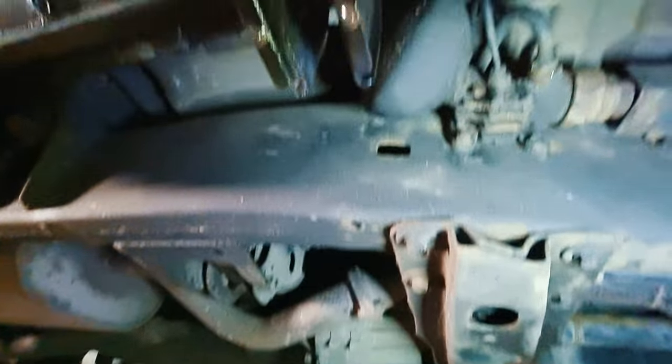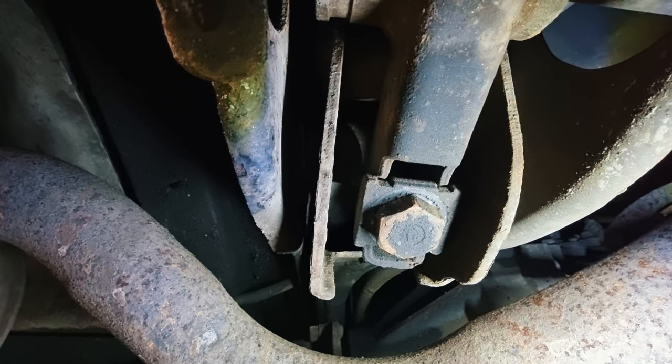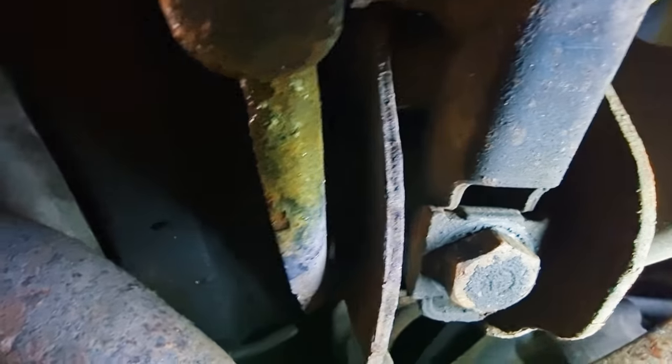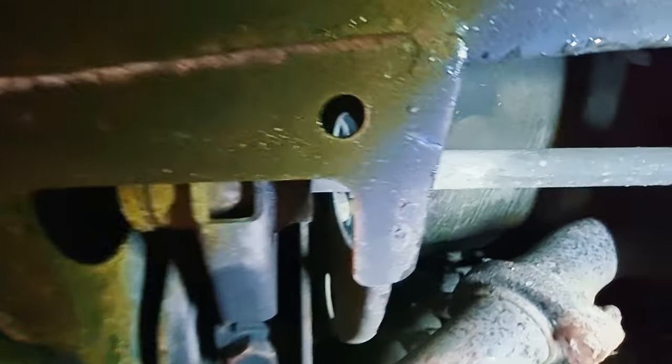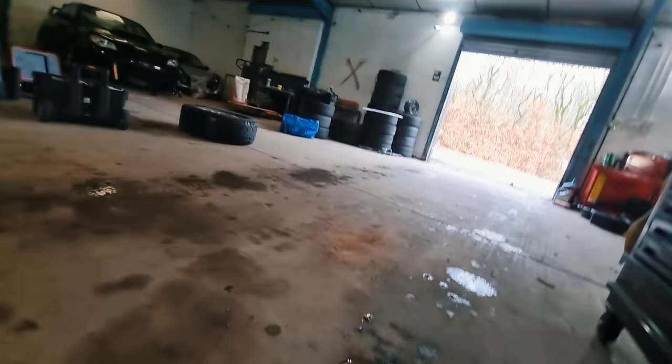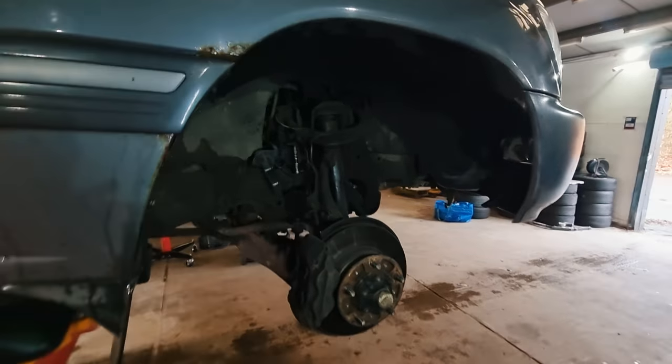On the front, to support the extra lift, I'm going to crank my torsion bars. Here's my torsion bar adjustment — you can see it's all freed off because it's been done several times already. Once I've got my sensors set, I'll crank that up so the torsion bars can support more of the front weight, and that way the hydraulic pressure isn't the only thing doing the work.